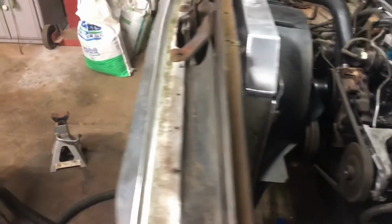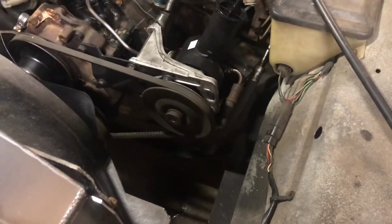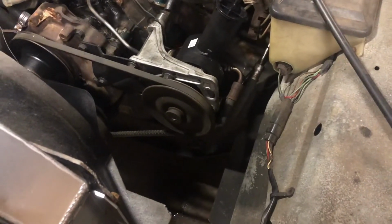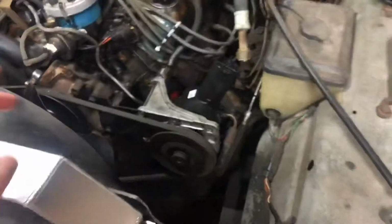All right, we got the radiator installed. Kind of. So I ran into a minor issue. The outlet on the bottom of this radiator, the 2-inch outlet, is a little bit different, and the radiator is not quite as thick as the old one. And so my hose is like an inch too short on the bottom. The top one, as you can see, works fine.